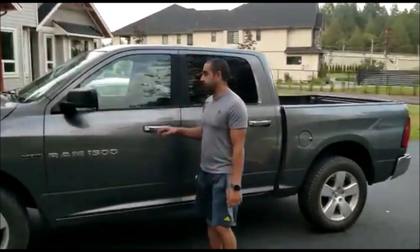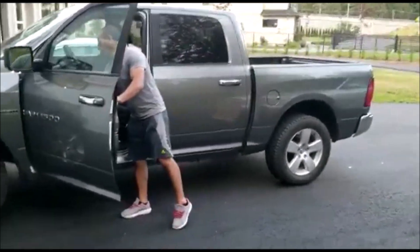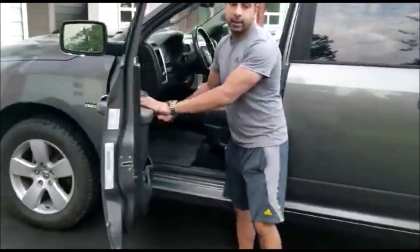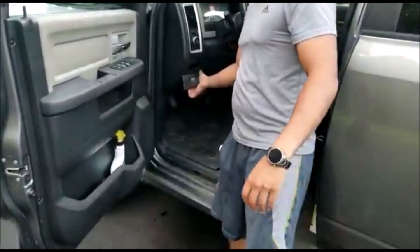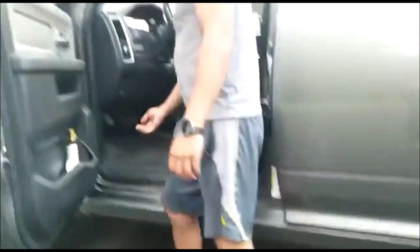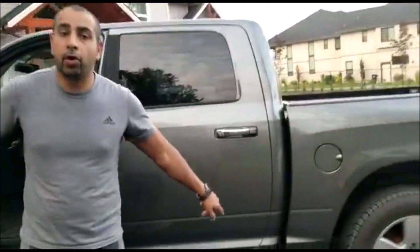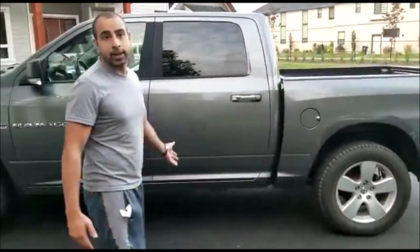The first thing you do is come up and pull your release — you pull it right here — and nothing changes, the light is still on. On this one, it's actually related to a switch. You pull all the way up on your foot lever to engage the parking brake and the light goes away. That solves that piece of it, but it doesn't solve why the cable is hanging down below.